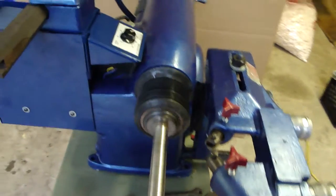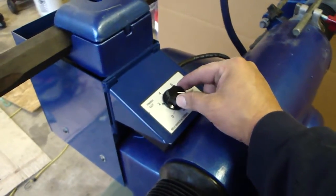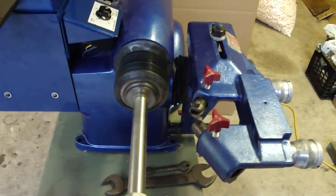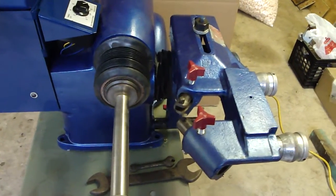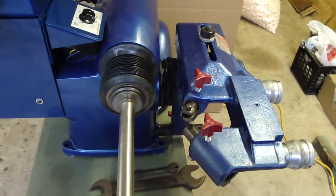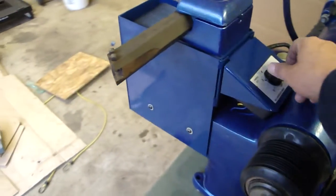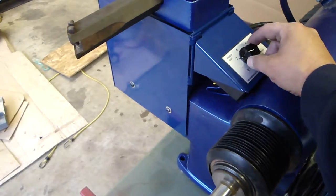I've got it in rough cut mode, which is the fastest speed setting, 10, and as you can see, as the cutters travel across the rotor face, they're moving away from the arbor. It's gradually working its way out, and it's a rheostat control controlling the electric motor, so you can simply slow it down or speed it up.